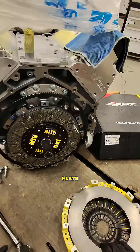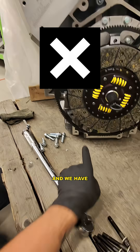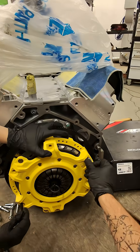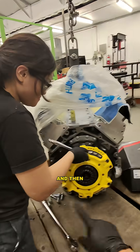We're ready for the pressure plate. There are two X's right here and we have to line it up. We'll look for the X's — the X's right here. All right, so we can start putting in the bolts. We'll start them by hand, five to six turns each, then switch bolts.